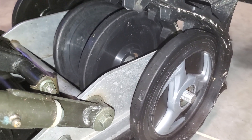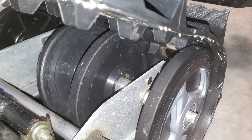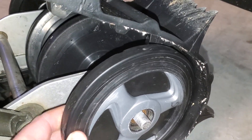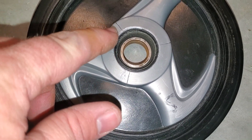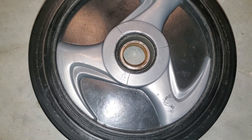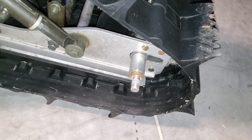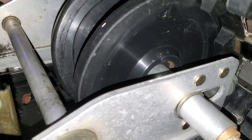We got that nut off and the track is loosened as much as it can be. The adjuster looks like it slid forward, not quite all the way, but most of the way at least. So first thing we're going to do is start on the left side — we're going to take this wheel off and try to keep everything in order when we get each one of these off. You can see this wheel is starting to get some cracks in it as well, so it's starting to get close. But having those redundant wheels, if this one does break it's not going to hurt anything on the trail. So it's important to keep all of these in order when they come off — I'm just going to make a line of all the different pieces as they come off. Had the wheel that broke been the one on the side we're on right now it would have been a lot easier, but unfortunately it was the one on the back side.